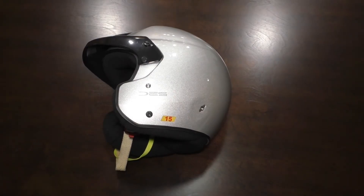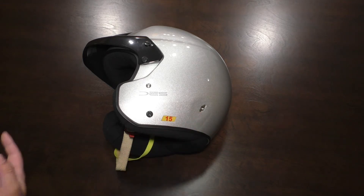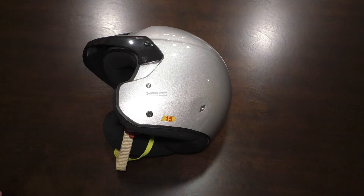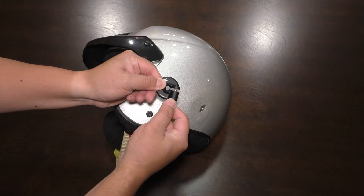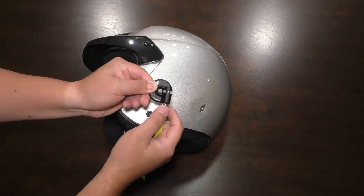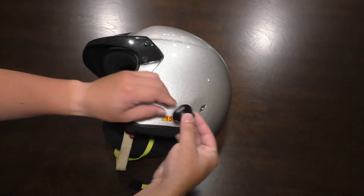To connect the Simpson Hybrid to your helmet, you have to install the anchors. The anchors go in this section of the helmet. This is an SA 2015 helmet, which means the anchors are already built in. On some older SA 2010 helmets — which shouldn't be used anymore since that standard is over 10 years old — the nut wasn't necessarily built in, so you may have had to drill it yourself. The Simpson Hybrid S lets you choose two different anchor mounts. You can get this Simpson quick-release style, which has a pull string and a detent that releases the tether from the helmet. It connects with an M6 screw into the helmet.